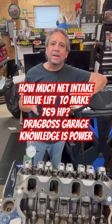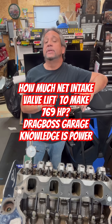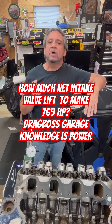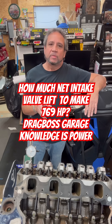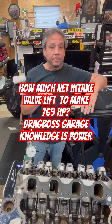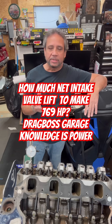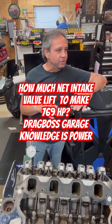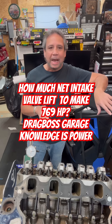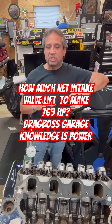One of the things I decided to do is I wanted to measure the net valve lift. Some of the fastest guys out there are designing their cams through net valve lift, not gross lift. Gross lift is 744 thousandths. The normal lash on this engine at hot is 22 thousandths. I always put it at 16 cold — I've been doing that for 12 years. Bob Beach told me don't bother doing it hot, do it like this. That's a loss of six thousandths, that's a gain of six thousandths, so I've always done it that way.